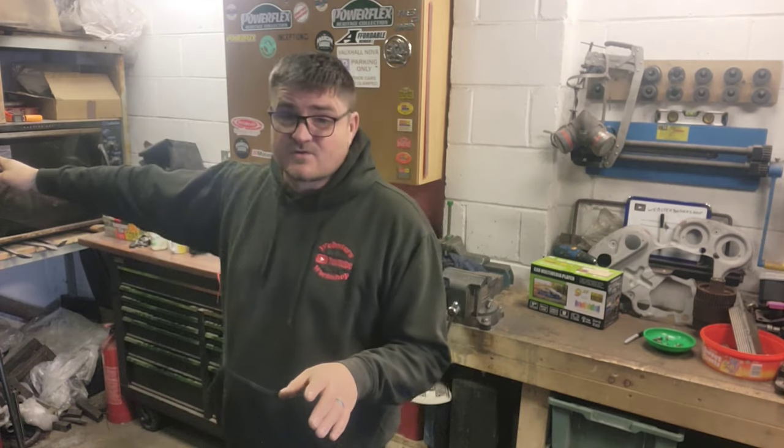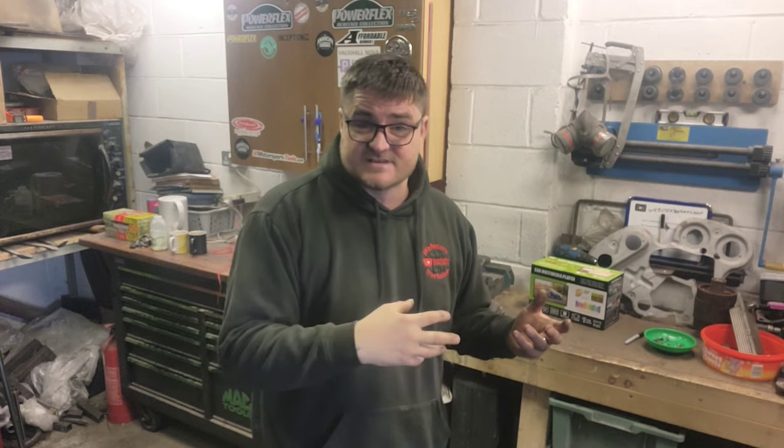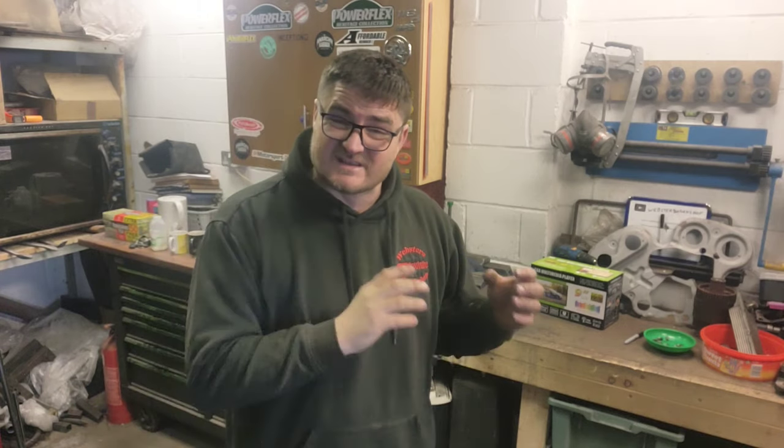What I'm going to do is whip the calipers off and do them one at a time, moving around the van. And since they're getting fully refurbed, I'm going to quickly whip them through my sandblaster, give them a blast and powder coat, bake them off so they're nice and protected and look good. Granted, nobody's going to see them except me and maybe the MOT tester, but I'll know they're done properly. I've got about a week and two days before I put the van on the road, so I reckon I've got enough time to get them all done — or at least the front ones, which I know are the major issues.